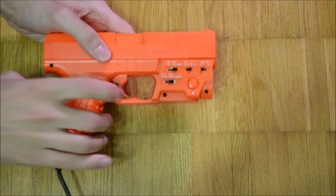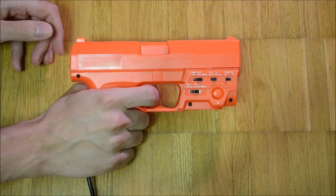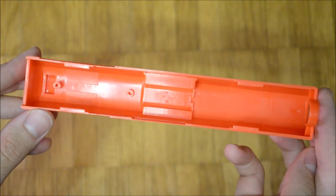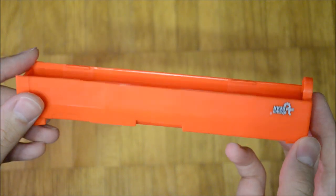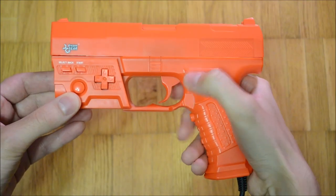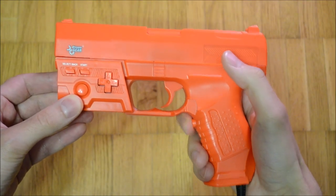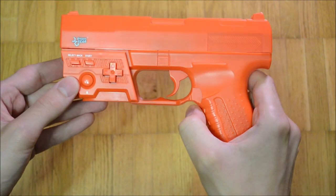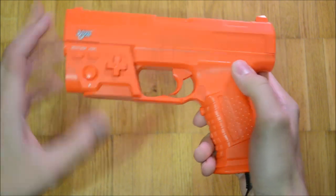While the slide is movable, it's not connected to the force feedback. On the inside, the dented rail that would grip into the motor gear was removed. The patterns of most serrations were altered. Instead of being a slight release lever, the C button is on the handle of the gun. It actuates a stiff push button switch and works very well.